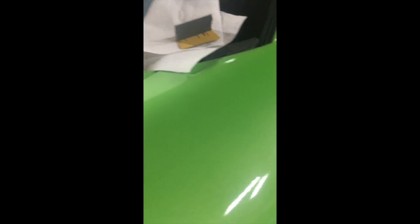So on my Porsche, if you zoom in here, you can see all my orange peel from my clear coat. I wet sanded the paint before I clear coated it, but doing this in my garage it left obviously not the results of a real paint booth. So I'm going to do some wet sanding with some 2000 grit paper and I'm going to take some buffing compound and my orbital sander and give it a whirl.